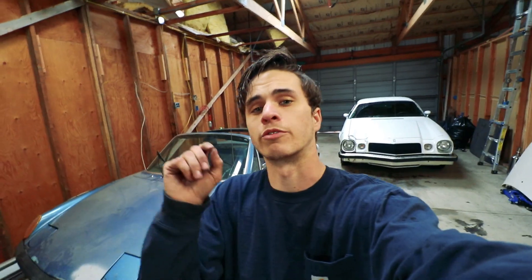It was just the line that went from the tank to the pump itself. The previous owner — and if you've been watching my videos for a while you remember he did all sorts of horrible crap — I thought I was over with his garbage, but obviously I wasn't. He hadn't put a hose clamp on that hose, so it was almost completely slipped off, and whenever the pump was running it would squirt most of the fuel out of that hose, causing the car not to start. I basically just threw a new hose on there, put a hose clamp, and it fires right back up again.